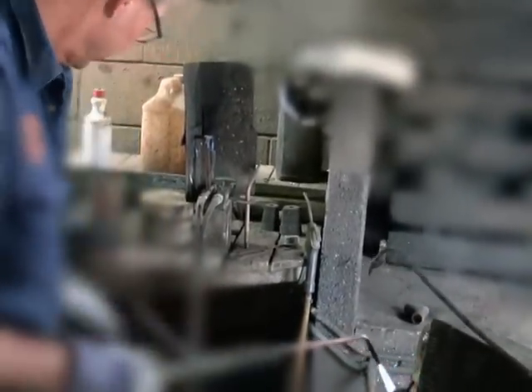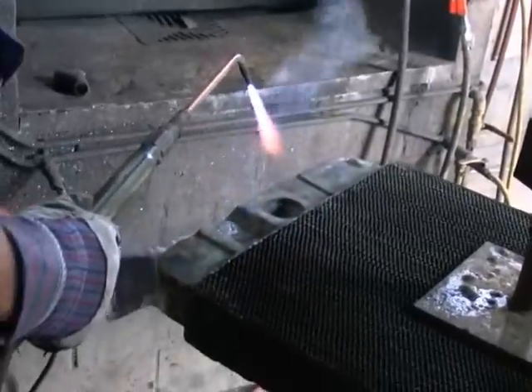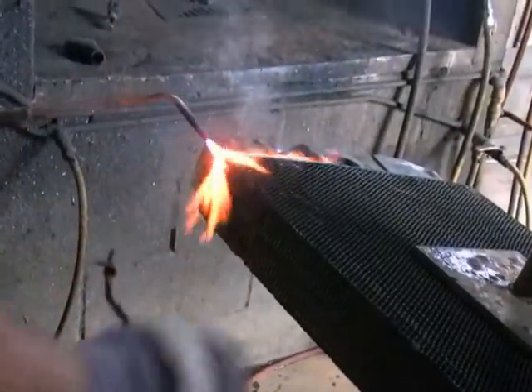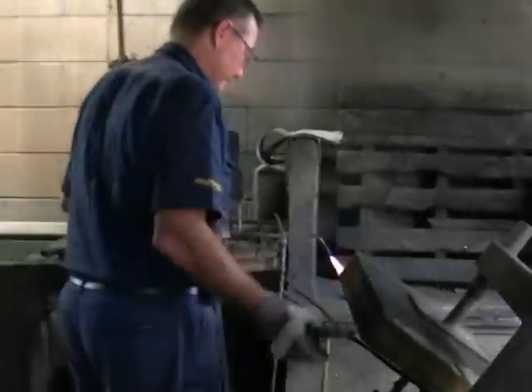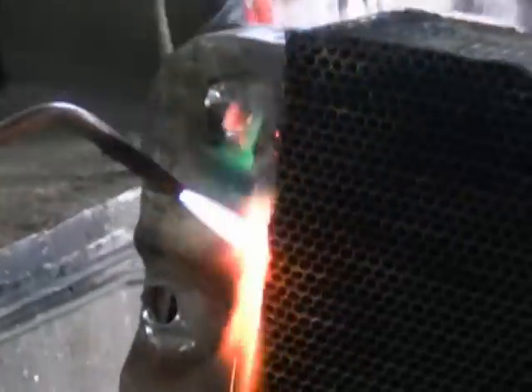What I have to do now is strip the solder out of the joint, being careful not to burn it. You'll see the hole there where I removed the drain plug. Coming down here you'll see the solder dripping out of the core past the crank hole — that's where I'm sweating the solder now.